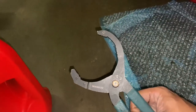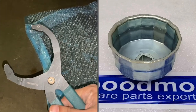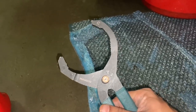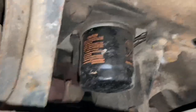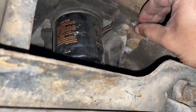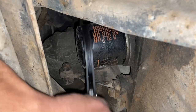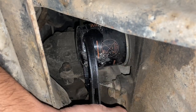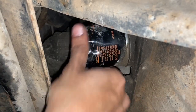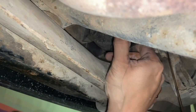I have this oil filter wrench with me — this is particularly useful for removing the oil filter. Maruti itself sells an oil filter removal tool which fits into a half-inch socket, but I decided to get this oil filter removal wrench instead. The oil filter is threaded onto the engine block. Attach the oil filter wrench towards the end of the oil filter where you see those indents and turn it anti-clockwise. Ensure that you do not apply too much force so it punctures the oil filter, as some amount of oil will spill out — be careful and collect it in the container.